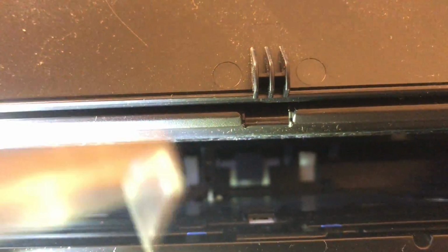if I can show you, there is a switch. See this? This switch here is the thing that tells the printer how much paper's in there. And sometimes it's when you get this problem I talked about earlier, you have to take the paper out, which brings it up, and then it pushes it in like that. You've got to be really careful you don't damage that, because it might be a new printer, or taking it to bits and fixing it, which nobody wants to do. So what we need to do is we've got to clean these print rollers.